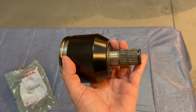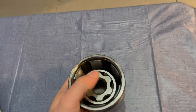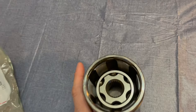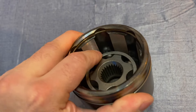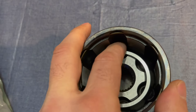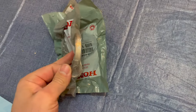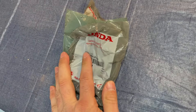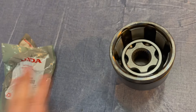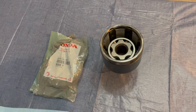Here's what your rear axle looks like on the inboard side — the side that goes into your rear differential. The easiest way to identify rear axle problems is a clicking noise when you turn right or left. You'll get pitting on the edges of the bearings. I carry a couple of these spares in case I need to swap them. You'll need a couple bands and a special tool to put the bands on the rubber boots, which I borrow from the dealership.